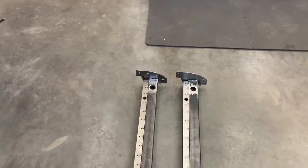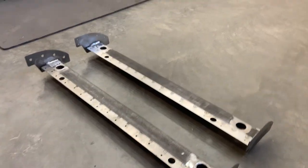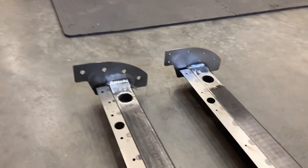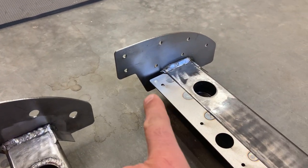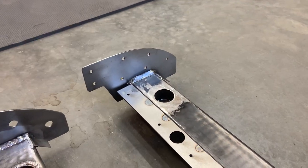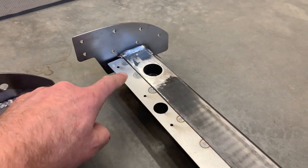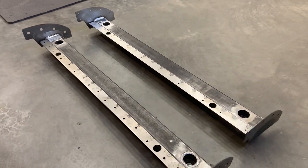These are the two different variants of the simplified design Vince bar. The first one here is the weld version, and this is the epoxy rivet one. The only differences are the hole patterns. The weld version has four large holes for plug welds, and seven 4.8mm rivet holes. The epoxy rivet version has larger plug weld holes and smaller 3.2mm holes, with a couple fewer of them. Otherwise I made them identical.